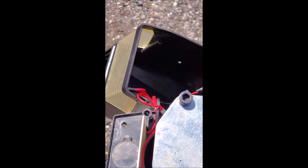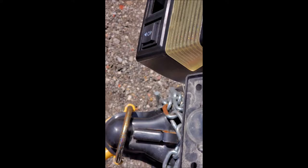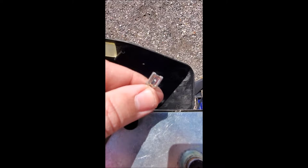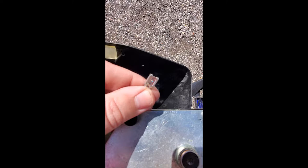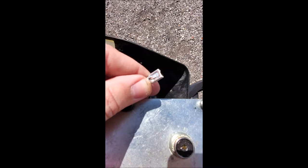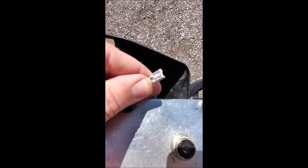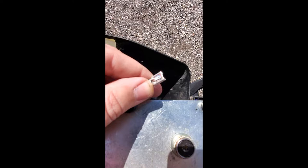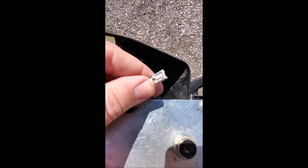One piece of advice: the new switch is fully installed and I've connected the battery and tested it — it works fine. When removing the blade connections, there's a little locking tab. If you have a steak knife or any small blade, in the center of the blade connection there's a little rectangular piece with a dot — almost like a small tab. If you can pull the insulation back off the connection and gently pry that tab up with a very small flat-blade screwdriver or the edge of a knife, it makes it a lot easier to remove the connections.